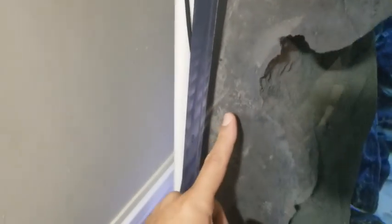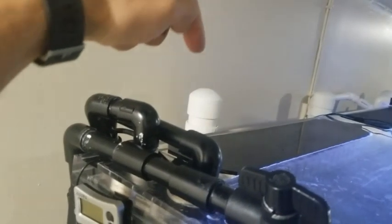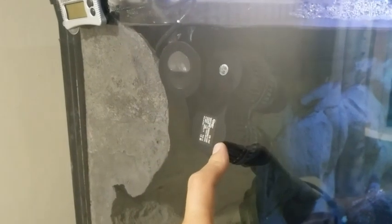This would be the strainer that goes behind the wall. And with the photos I showed you, I took the strainer and divided it into two parts so that I'm straining below here and midway point as well. And this would be the output, which this time around, I just shot it straight out into here, and some of it gets pushed into the power head. I did the same with the other side over here, and just mirrored the same idea.